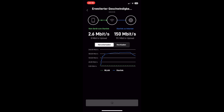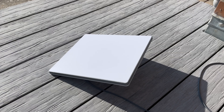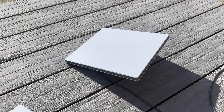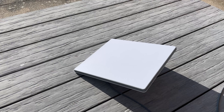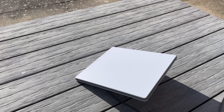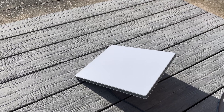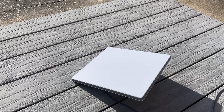I ran an extended analysis and it turned out the Starlink satellite connection itself was well aligned, getting 150 Mbps — even with a wall behind me. However, the Wi-Fi connection from the dish was only 3 Mbps. That's because I was about 10 meters away with a partial wall creating radio signal shadow. The Wi-Fi really only works well if you're very close with no walls between you, or if the dish is elevated rather than sitting on the ground.